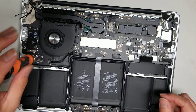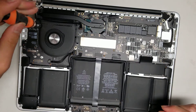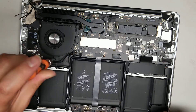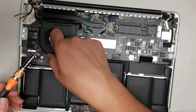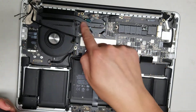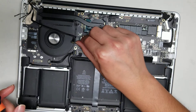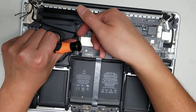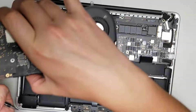Take this screw out — remember not to mix up the screws. Then take out the fan screws. The fan can actually stay attached to the motherboard; it goes underneath the heat sink, so you'd have to lift it all out anyway. To remove the fan connector, flip this connector and use the block that sticks up to push it out. I'll leave it in — the replacement board already comes with a fan connected.